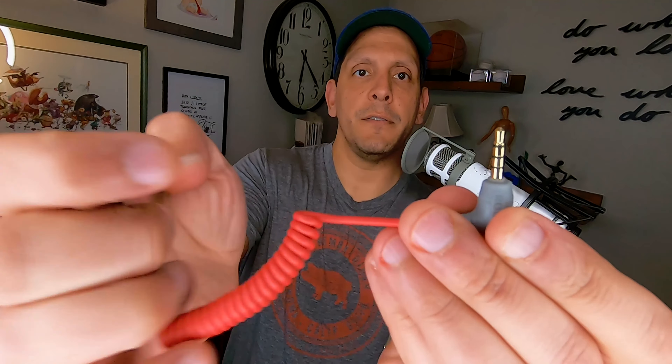Since the audio coming out of both of those microphones is TRS and the audio that goes into the iPhone is TRRS — a quick explanation: TRS is tip, ring, sleeve, and TRRS is tip, ring, ring, sleeve. This is the Rode SC7. I'll leave a link to all of this stuff in the description. It's a 3.5 millimeter audio jack adapter, so we do like that and now we can slide that into the iPhone.